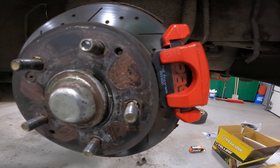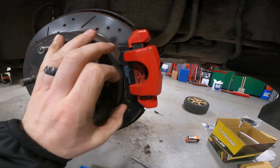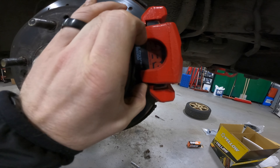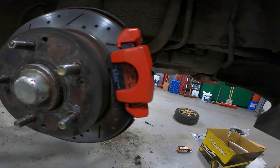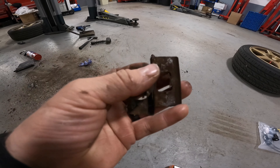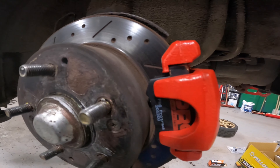So this has been done on purpose, but you can see your pad rattles around like this - you don't want your pad to rattle around like that. That is because you're supposed to have shims in it, but we did this on purpose as a demonstration. First point: make sure you put your shims in. So that's the demonstration - top tip.